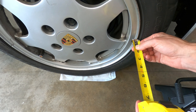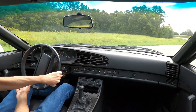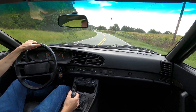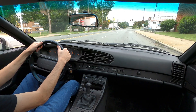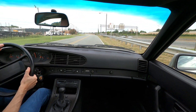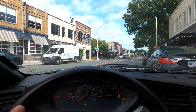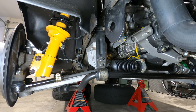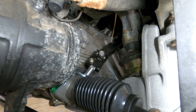So with that out of the way, let's take the car out and see how it drives. Driving the 944 with a manual steering rack — as for initial impressions, the steering is obviously a little bit heavier at parking lot speeds, but it feels great once the car is up and rolling above 20 miles per hour, and the feedback is notably better than the power rack. The steering wheel does experience a bit more movement when traveling over large bumps or holes in the road surface, but it mostly tracks straight with minimal annoyance on moderately bumpy roads. You definitely get a better sense of how the tires are responding to the road surface, and that transfers directly to the steering wheel for a nice feel. Things like parallel parking are a bit more of a chore, but not impossible, and as long as you can keep the car rolling, it can be maneuvered without too much effort. Overall, the manual steering kit is a quality setup, so if you're tired of dealing with power steering leaks and you want an improvement in driving feedback on your 944, this kit may be worth a look.